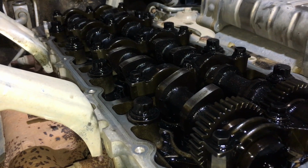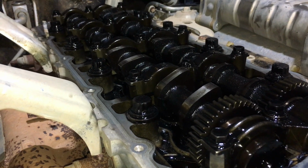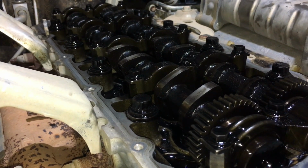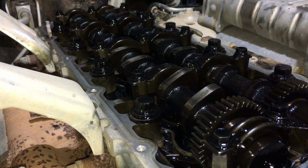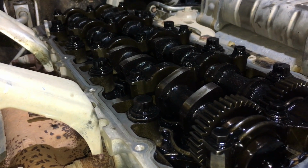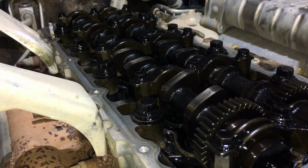There's no need to buy a puller because often it's not going to get it out usually. If you can get it out with a puller, then the injector's not really stuck. You really need to have a decent quality pry bar and a decent quality shifter and some muscles, I suppose. And that's the way to get it out. So, look, I hope that saved you.